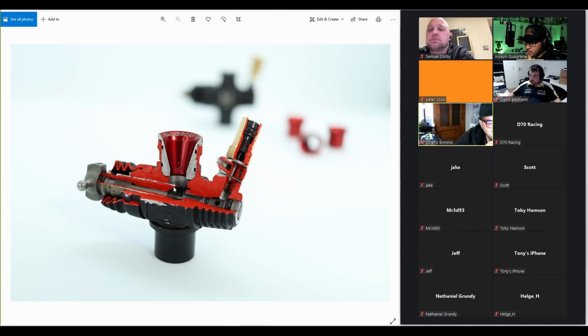And that's what makes tuning the engine so much easier when you measure the idle gap. Basically anyone can do it. I mean, that's really the instruction right there. So you have an engine, it's warm, it's ready to get tuned, you have measured the idle gap, you know what it is, and you just let it idle and you listen. Does it idle? Is the idle stable? Does it go down? Does it go up? It's really as simple as that.